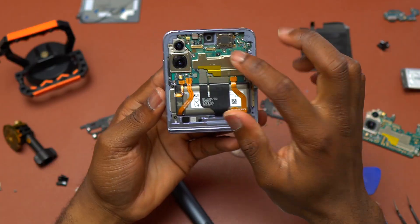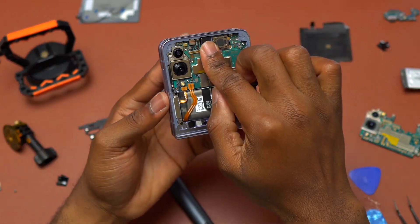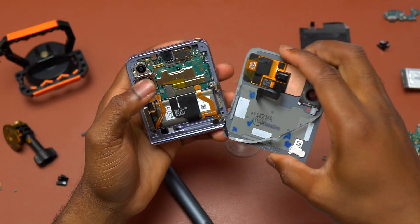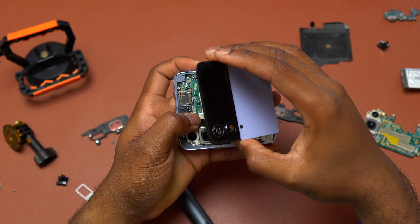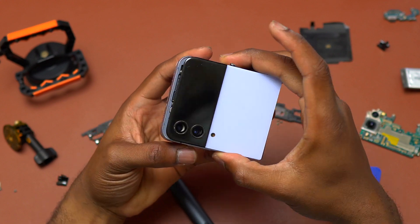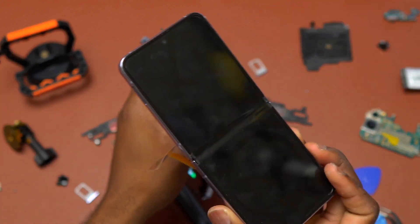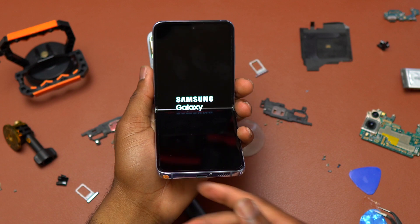After reinstalling all major components on the new screen, finish with the battery flex cables — connect the smaller battery and bigger battery last. Then connect the flex cable for the front cover screen. With all flex cables connected, the only thing missing is the plastic covering for the front camera and front speaker. The device is closed and I press the power button — it has started to turn on. The new screen is starting to turn on; this was compared to the old broken screen.